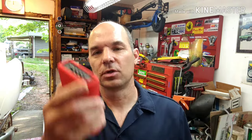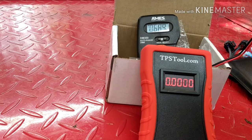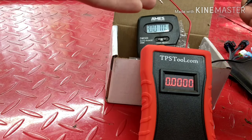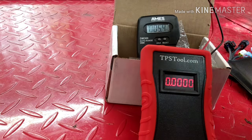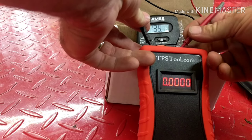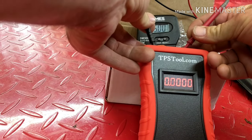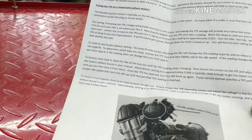The display gives us our reading and it puts out a constant five volts. Let's throw this on and verify — I'll take my voltmeter, touch it to the positive and negative five-volt and ground connections, and confirm we're getting a steady five volts out of it. And there it is: five volts, dead on, perfect.